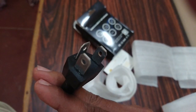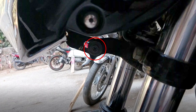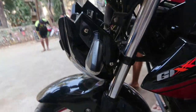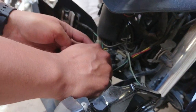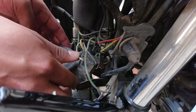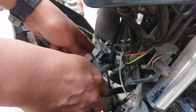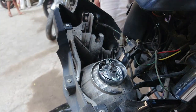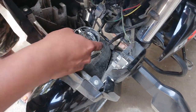Let's start the installation process. You just need to remove this screw and the whole headlight comes out. Check your bike for any extra screws as well. First unplug the connection and remove the dust cover, then press the locking pin to remove the halogen bulb.